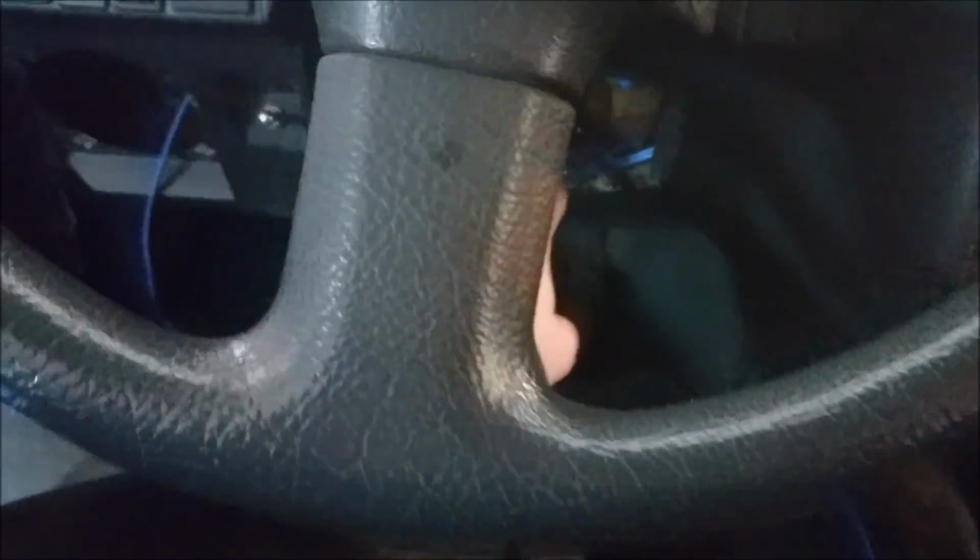Come up through here, right along here, zap strap there, and then now run a new speaker wire there, run through the carpet, bring it down through here. I'm going to have a small incision where I'm popping all this out. So I'll make another one back down here, and I'll pop all the new speaker wires out down there, and it's super easy. Same carpet for that rear speaker over there. And then we'll have all our speaker wires ready for our amp.